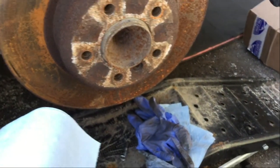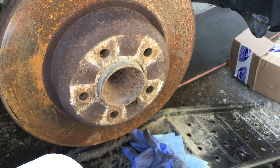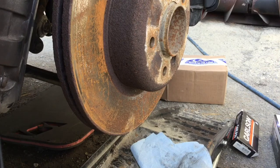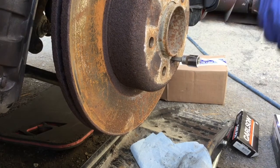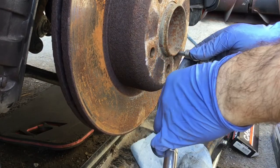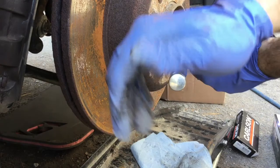When you torque these bolts back on, you definitely want to put anti-seize and also you don't want to over-torque them. This is a 6mm hexagonal socket — set that in. And then we have a situation. If you have trouble with this and it keeps spinning, you can put — I'm going to try it, I think I might be lucky.